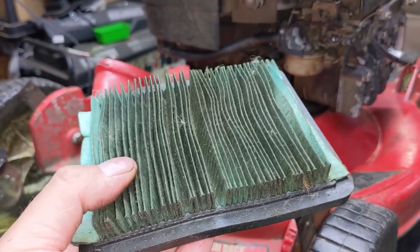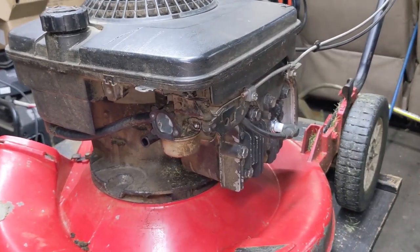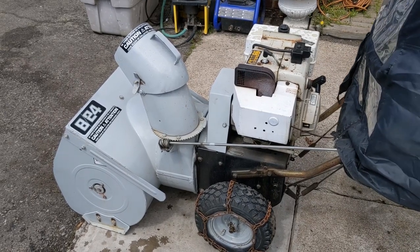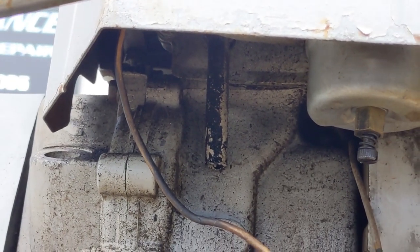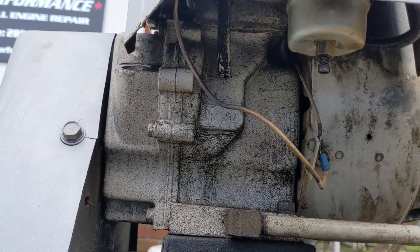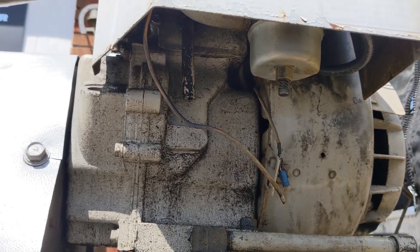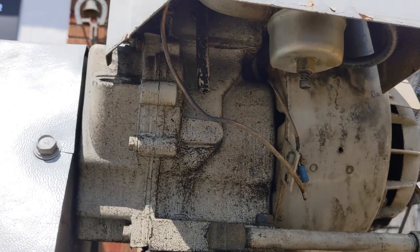You're going to be completely coating your air filters with oil. It's going to create an airflow restriction, which is going to create a rich fuel mixture, which is then going to foul your spark plugs. A common engine that has this excessive crankcase pressure venting a little bit extra oil vapor would be these old-school Tecumseh HMSK 80 snowblower engines. On these engines, they have the crankcase breather tube just coming out the side venting to the atmosphere, which is what we're going to be doing to this Quantum 5 horsepower lawnmower. As the engine gets older, the cylinder starts to wear, the piston rings start to wear, and you get increased blow-by — that's the technical term — because a little bit of that combustion is going to blow by the piston rings and then increase your crankcase pressure, thus increasing the pressure at the crankcase breather tube.